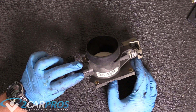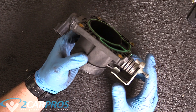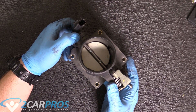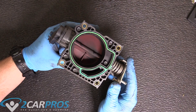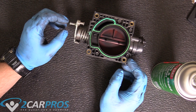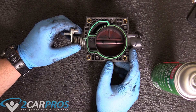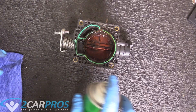Over at my workbench, we can see on the back of the throttle plate there is significant dirt — what's called coking. That occurs because your air filter can't remove all the impurities out of the air; over hundreds of thousands of gallons of air going through this over its lifetime, little impurities build up. To fix that we'll use some carb spray. I know some will say to use throttle body spray — I've been doing this a long time and I haven't seen a difference, but I completely support using throttle body spray if you prefer. I have about six cases of carb spray, so I'll be using that.